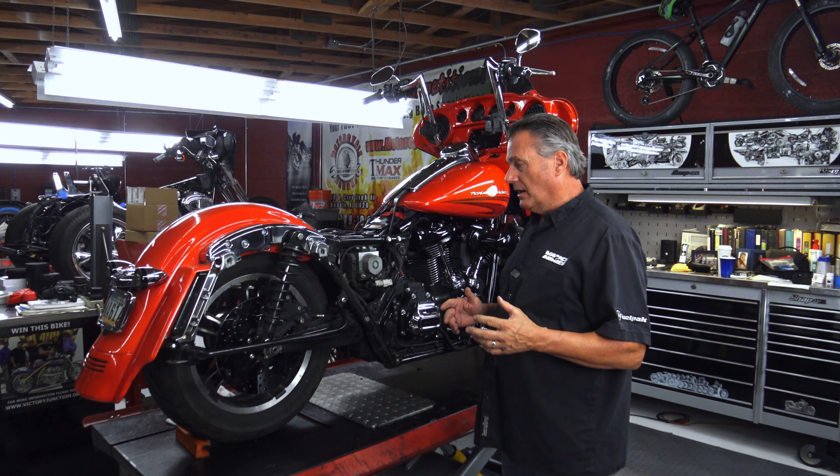Some guys say that's because of fuel injection — well, that's just not true. Back in the day with a carburetor — I grabbed an S&S here that I've actually added a fuel circuit to with a Thunderjet — at around 1,500 to 2,000 RPMs you'd actually have fuel pour out of the Venturi and onto the engine. We used to call that the fuel wall, because you'd hit that wall as the pulse wave came through and affected the fuel going into the Venturi. What's great about Thunderjets is we can add circuits and deal with that fuel wall — we can run one to two sizes smaller on the main jet and even a smaller intermediate jet to compensate for that pulse wave.